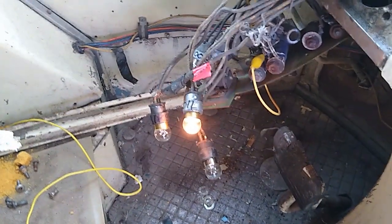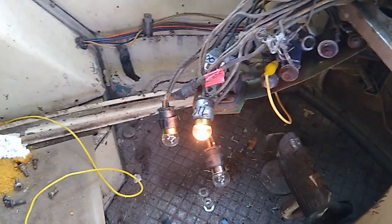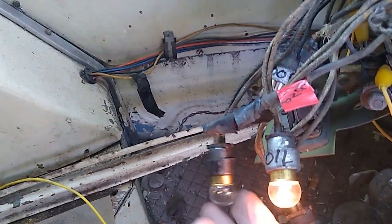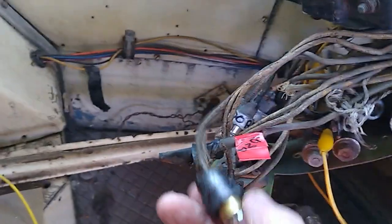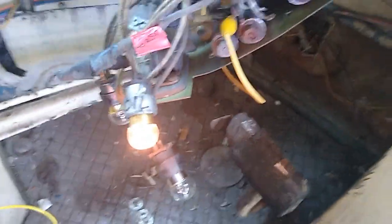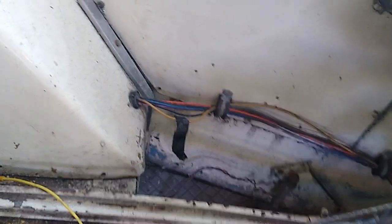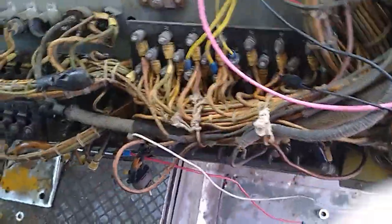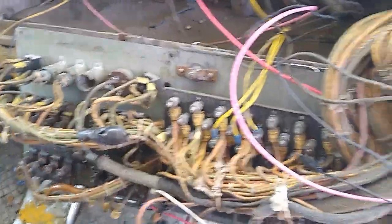This light again is lit because it is the low oil pressure, and because the engine isn't running, of course, the oil pressure is low. The other lights are the emergency door — do not ignore that circuit. Make sure that circuit works because when you're driving down the road, do not disable your emergency door. You may need it. There's a light for low air pressure, and then there are two other lights: the high beam indicator and the fog light indicator. It's important that all these features work, not only the alarm signals, but also the high beam and low beam.